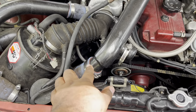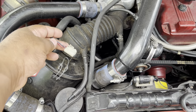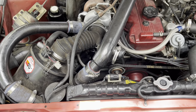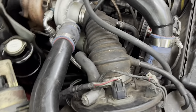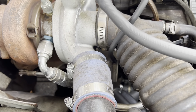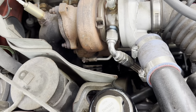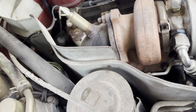We're going to fix this pipe — it's about to pop out. We're also missing the electronic wastegate that goes right over here. This is an '89-only thing where it has an electronic wastegate actuator valve, but this wastegate has been replaced with a single-nipple unit — the '89 has three nipples. So that's been changed.